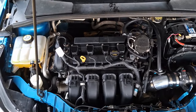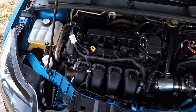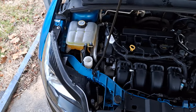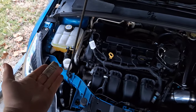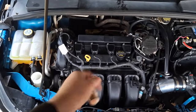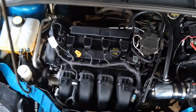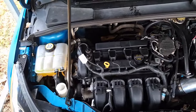Unless the cat plugs up — which is rare in my experience — I wouldn't worry about the P0420. Other than the automatic dual-clutch, these are solid cars. I would service the cooling system and get the updated design coolant in — Motorcraft VC13G is the part number. Drain and fill it several times. Personally, I change my oil every 5,000 miles using full synthetic. If you've got a high-mileage Focus, you might want to switch to 5W-30. It recommends 5W-20, but on my high-mileage Focus I put 5W-30 synthetic in during the summer months; if it's cold out, I'd use 5W-20.